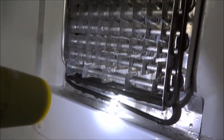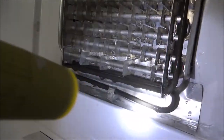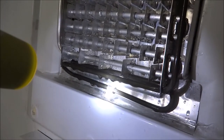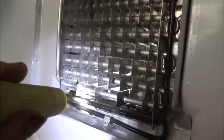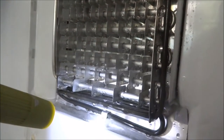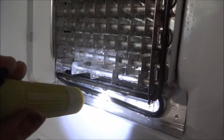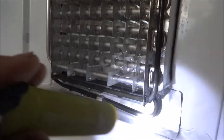That silver thing in the middle is basically supposed to go down further in that tube — it can be pushed a little bit further down. What I do is I take a piece of coat hanger and wrap it around. This dark thing here, that's the heater, and that heater is supposed to defrost all that water down there. It's not working because that silver thing in the middle doesn't go far enough down that drain.